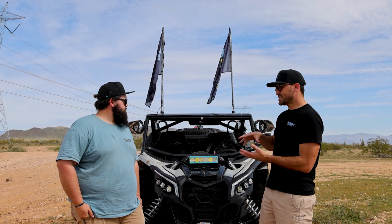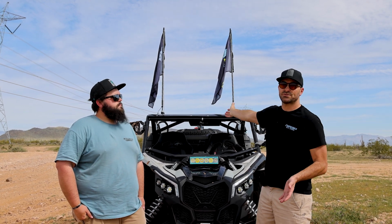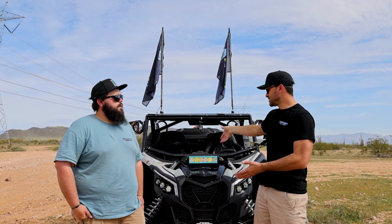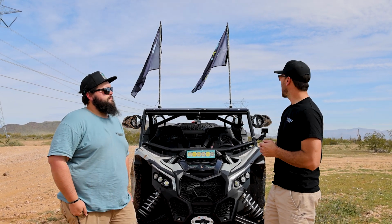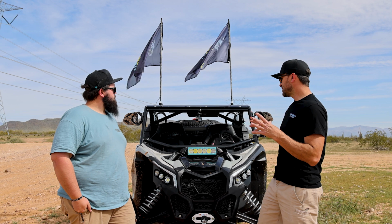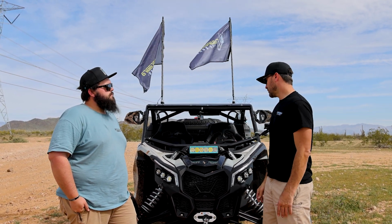So being that we're at a setting where we've got all that bottom out control, I wouldn't hit stuff like this much faster than that in general. This isn't a race car. Right. I'm very happy with hitting this drop off at 65 miles an hour. And like I said, it's controlled. We've got plenty of bottom out control. The mid stroke, I'm really impressed, guys.